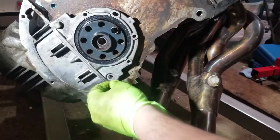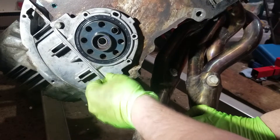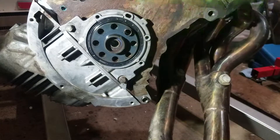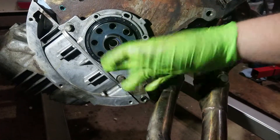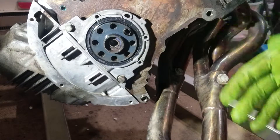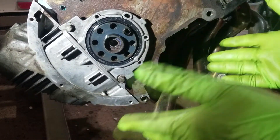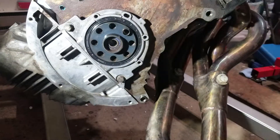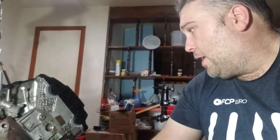As I was pushing that on, it just fell off the installation tool. That installation tool basically goes around the edge of the crankshaft and guides the seal on. All the PTFE seals you'll see have that kind of installation, especially when it's up against something like this. That's just a quick introduction to dealing with these types of seals — just one quick item I wanted to knock off the list tonight, so I figured I might as well install them and talk about the tools.